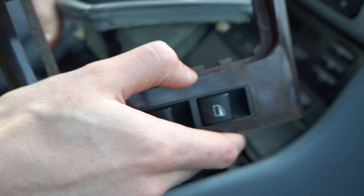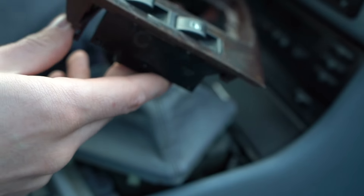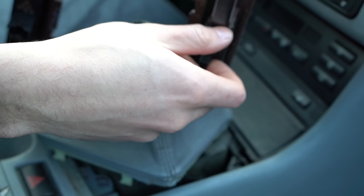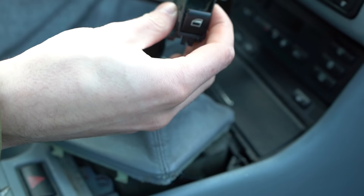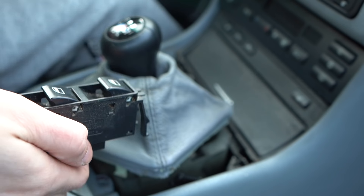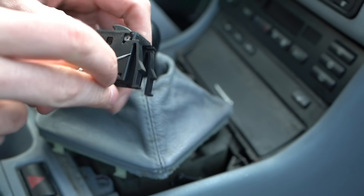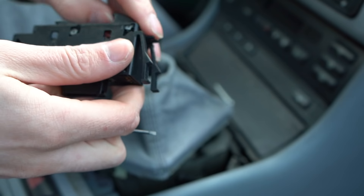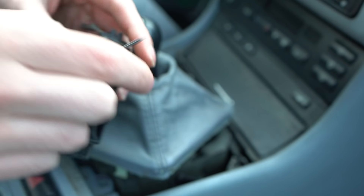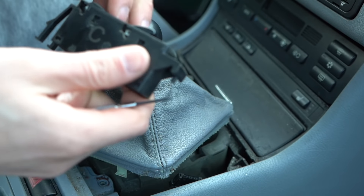Now that it's off, wedge it through like that and it pops off. The next thing we want to do is actually remove the switch itself. There are two plastic pieces here — pop them off, pull down, and it pulls out just like that. This is where the small screwdriver comes in. First thing we want to do is pop off the switch caps. A lot of people on the forums say you don't need to, but I'll show you why you do — when you line it back up it'll be difficult. Just take the screwdriver, pop it in on one side, it pops off, flip it around, other side pops off, pull it out, put that somewhere safe.